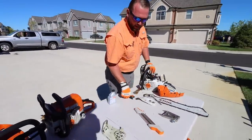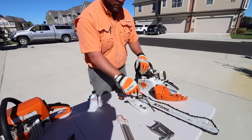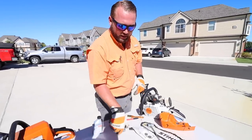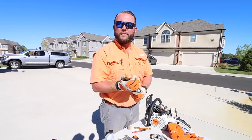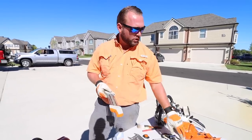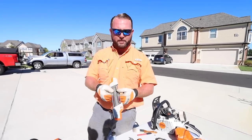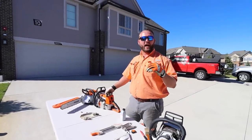I have a couple of parts that I keep in my tool bag for when I'm cutting out in the field. I keep a brush. I keep a Sharpie because when I need to sharpen my chain, I'm able to mark the dullest head. This is a stump vise — you take your axe and pound this into a stump, then you're able to clamp the saw into it. And then I use my two-in-one file to sharpen the saw. These two-in-one files are excellent, about $35 and a great investment.